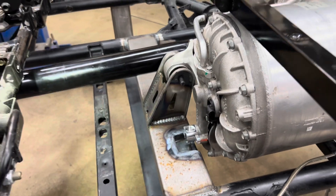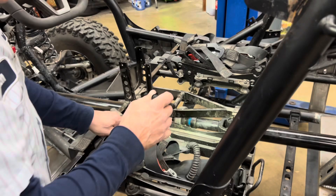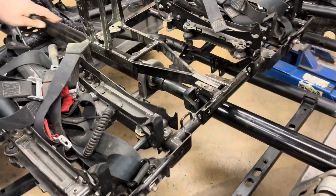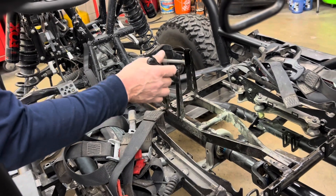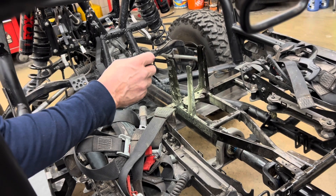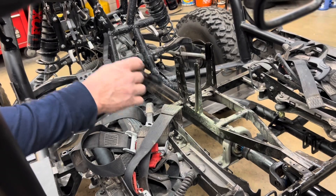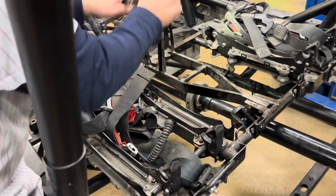You can see we've got the front driveline in, the seat brackets and mounting in. We've got a little bit of a clearance issue here, but most of this can come out because I will not have a shifter. This will be push-button drive, park, neutral, reverse. On a Tesla there is no park pawl on this motor, so park is neutral.